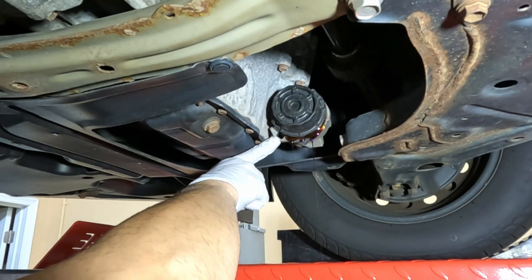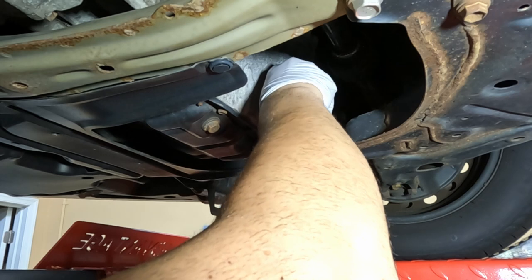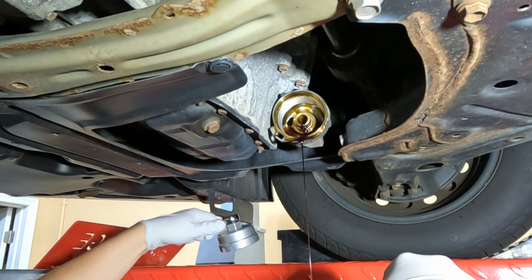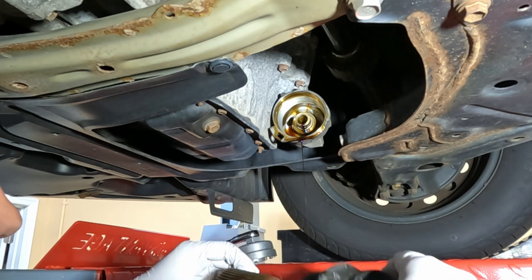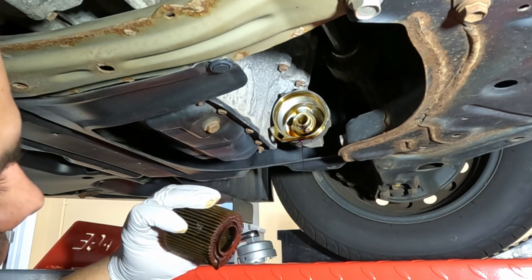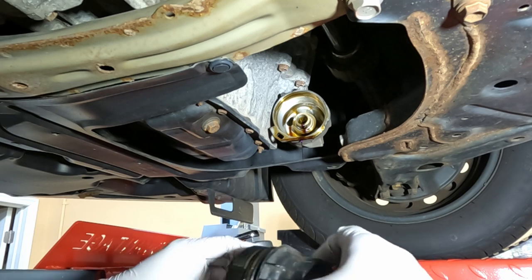You'll notice a little bit of a hole here. Some of the early cartridge cars had a little bit of a spring retainer clip there, but Toyota got rid of them shortly thereafter so they don't really have them anymore. That came off easy. Everything looks good — it's the old filter. I run all the genuine Toyota filters. Everything looks beautiful, nothing there. So I'll let that sit and drain down.